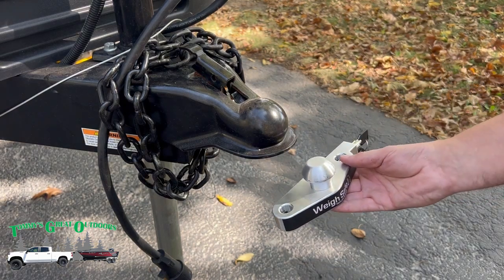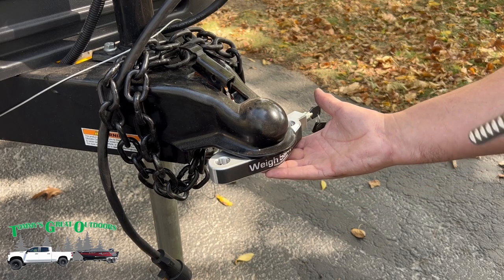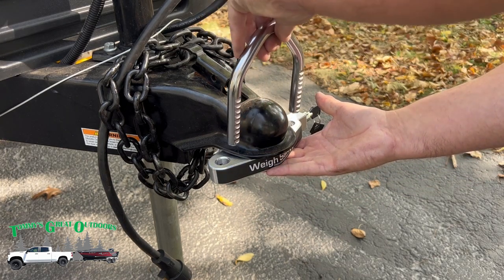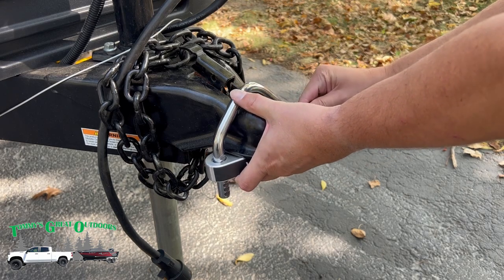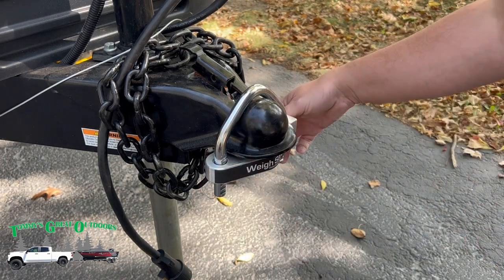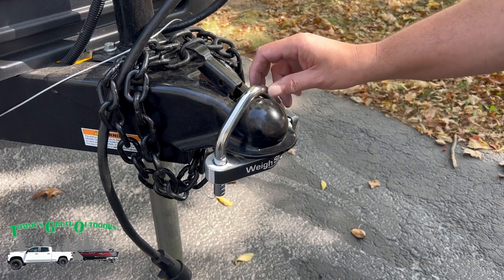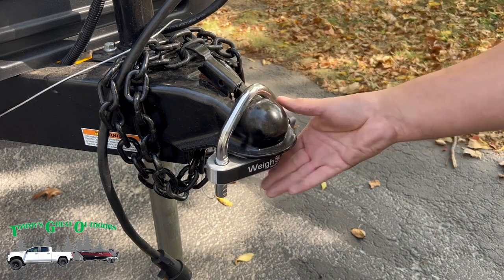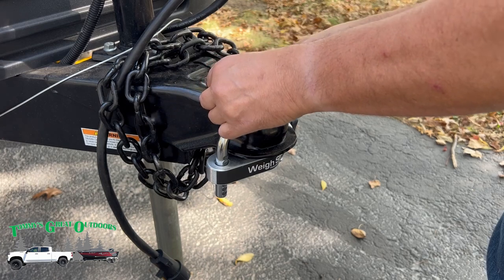This first lock is pretty straightforward — it's the trailer coupler lock, and it's got a ball on it. It's a pretty generic sized ball; it should fit on most trailers. This particular one is a two and five-sixteenths but it'll fit on a two-inch as well. Basically it sits under the coupler just like you see, and prevents somebody from coming and putting whatever their ball mount is up into your trailer — preventing theft that way. You've got the top part here; it doesn't matter which way you go, either way is fine. You just have to line up the ribs on here with the lock, and once you do that it'll sit under just like that. Take the little rubber boot, cover that up to keep it clean. Some locks secure from both the bottom and the top; this one just secures the bottom, so we've got this extra padlock to secure it from the top.